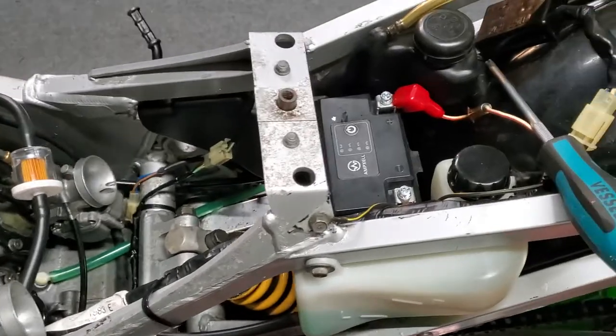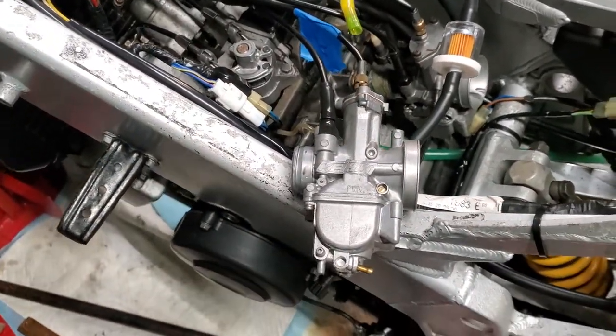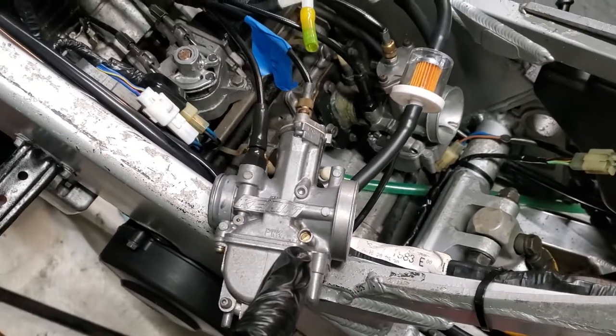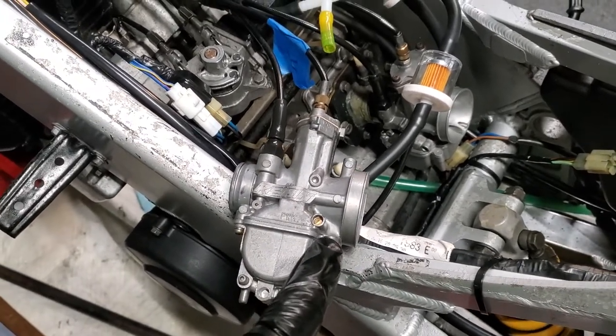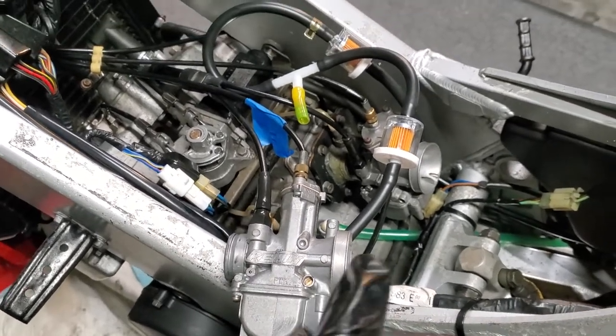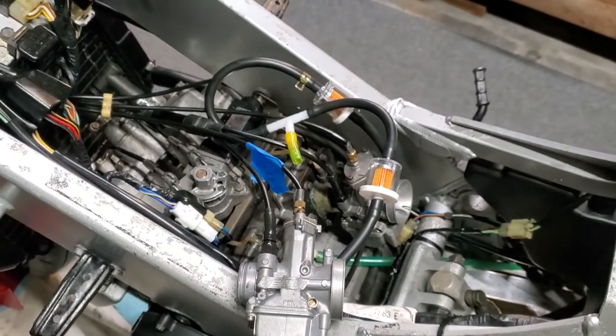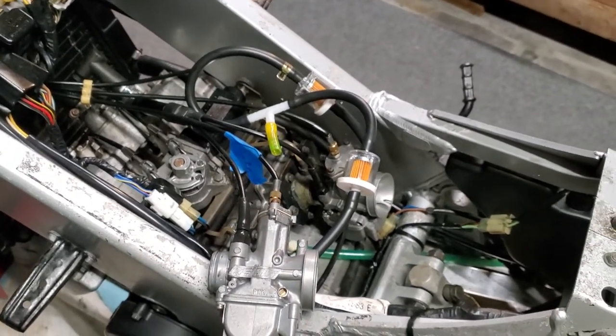Those are a few of the basic checks. I also have a newly charged battery in there. The next move is to set the air/fuel mixture screw to the correct one and an eighth turns — I had it at two before. Then I'll re-hang the fuel bottle and I think we'll be in business. I hope that helps — I appreciate any likes and subscribes, thank you.